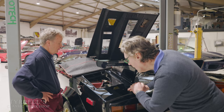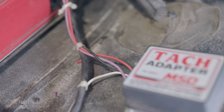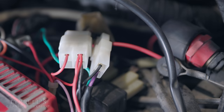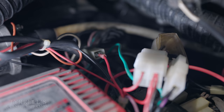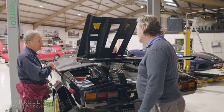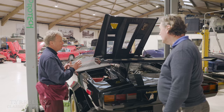This is obviously particular to the US market with the injection, so it's got fuel pump relays that it wouldn't normally have. I found that by looking on the internet. I broke it down in two really - we had ignition trouble and fuel trouble. So first let's sort the ignition out. Once I knew everything was in the right place - not necessarily in the right order - once I knew that worked properly, I could put some proper plugs and terminals on. Then I moved over to the fuel issue, finding out how it should work and why it didn't. It kind of jumped a few steps and went straight to the fuel pumps to find out if they worked, which they didn't. Once we got new pumps on, knowing they work, we backtracked up the circuit.